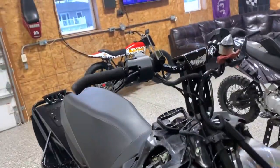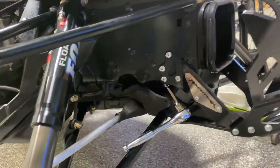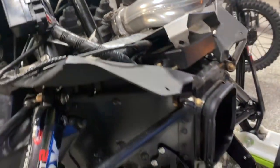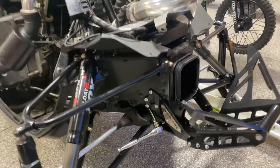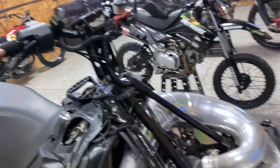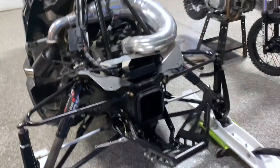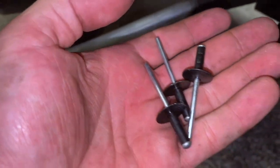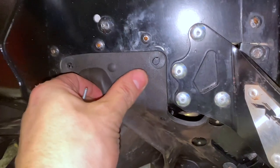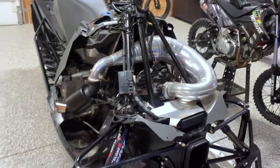One thing I noticed when I was doing this is I didn't feel like I was getting enough grab on that bolt. I'm sure there must be a slip nut on top or something there that's keeping it from getting tight. A little tip: if you put a little tension on the bars while you're turning down below, it helps tighten it up — that was really the only way I was able to get that done. Go ahead and drill those rivets back out, get some fresh rivets, and put that rubber boot back up there.